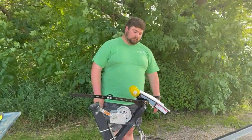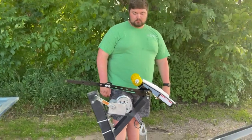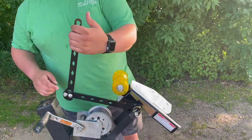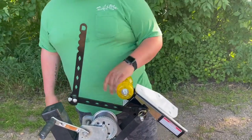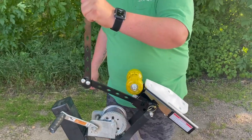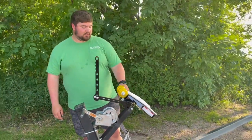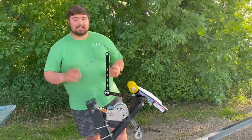When we're traveling, we'll still use the winch just to play it safe. We switched the handle around a little bit so it has like finger grooves or whatever so you can grab it and pull it. We just flipped the handle so it goes out like this, and when you pull it, it releases. We're going to load the boat up now and see if it latches on, and we'll get this angle just perfect, then tighten this bolt all the way tight and that'll be it.